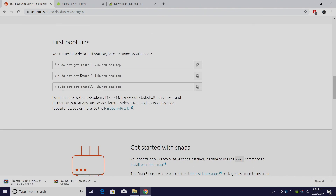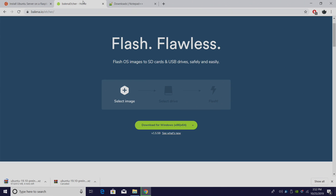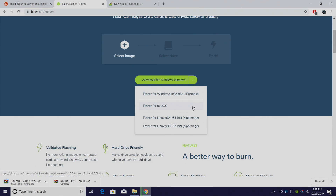If we scroll down a little bit on this page we can see there are a few different desktops we can install: Xubuntu, Lubuntu, and Kubuntu. I recommend Lubuntu on the Raspberry Pi 4, but in this video I'm going to be working with stock Ubuntu so we'll have the GNOME desktop installed right out of the box. The next thing we're going to need is an application to flash this image to an SD card — we're going to be using Etcher. From the dropdown here you can select Linux, Mac, or Windows. I'm going to download the Windows version.